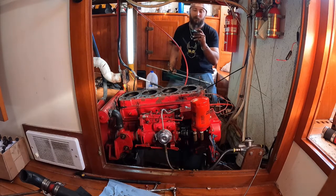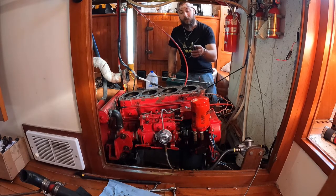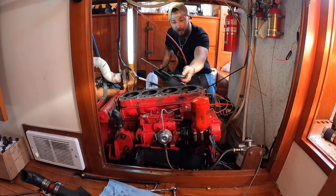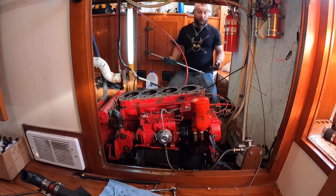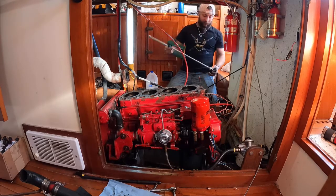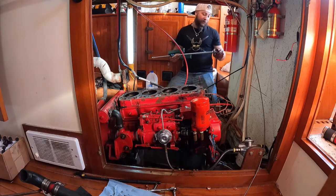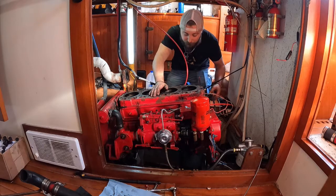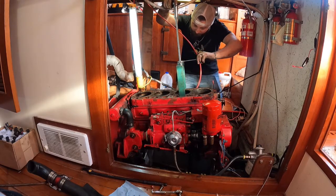Hopefully it works — I haven't tested it, so I'm pretty proud of it so far, but we'll see. I also made this at home without specs — I just looked up the bore size and cut a little inlet on the inner side to just under that bore size, and then the outer to the thickness of the sleeve. The goal is to grab the bottom of the sleeve; this straddles the block and the liner should in theory come up through here. I used scrap metal and about $10 worth of all-thread.